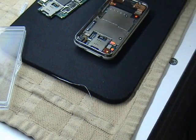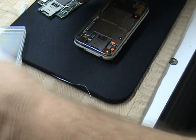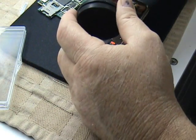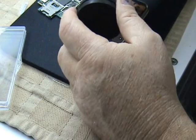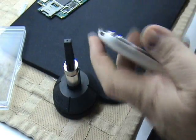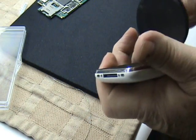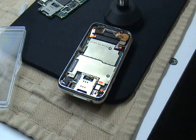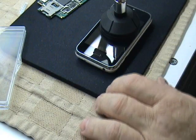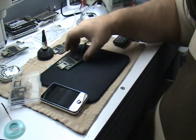When you're taking out the LCD, you don't need to pry — use little suction cups; that's the best deal. You just stick it on there, take the two screws off, put it on the bottom part near the button, and kind of rock it back and forth. It'll pop right up. It's so much easier than trying to use a pry tool to take those things apart.